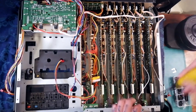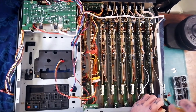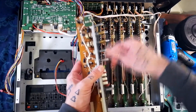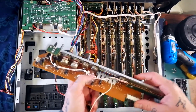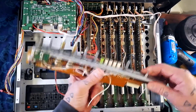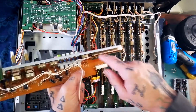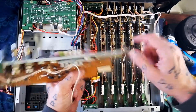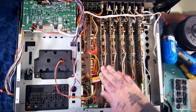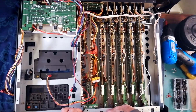Each mixer daughter board has one, two, three screws that need to be removed, screwing into the metal chassis — so they're of the narrow ferrule type. If you haven't already removed the knobs from the front, most of this can be cleaned and soldered without removing any of these washers or screws. To open these up and pry them up if they get really filthy, you still need to desolder them in order to pry open the base. For the purposes of this video I'm not going to remove the remaining five, but you would repeat that process five more times.